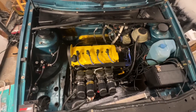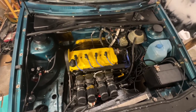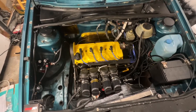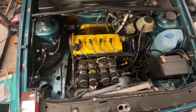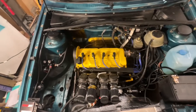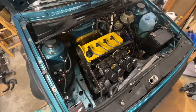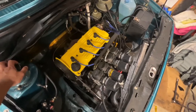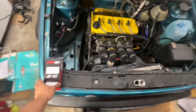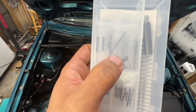So I didn't have it on video, but the 190s actually didn't end up being big enough. I was still getting AFRs of 14s to 17s on wide-open throttle. So I ended up with some 198 jets in there, and now AFRs are showing in the 13s when I go on wide-open throttle. So I think with a little bit of timing advance I should see 12s, and I picked up this Dynojet kit from GP Bikes.